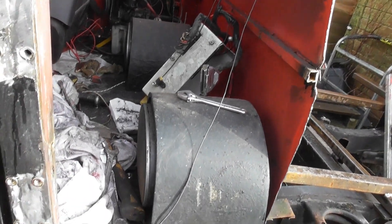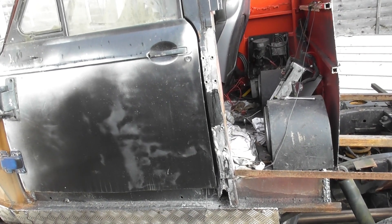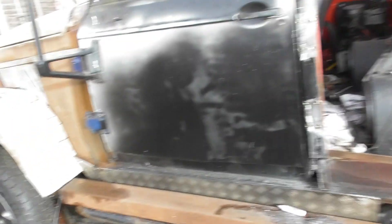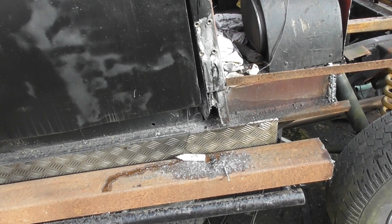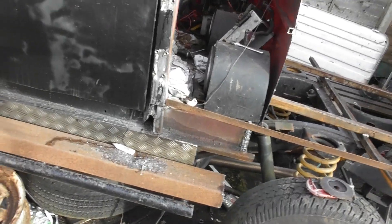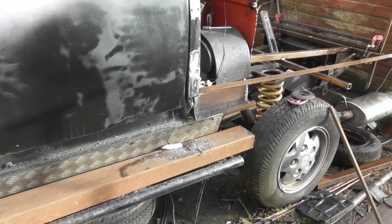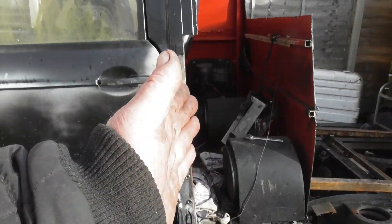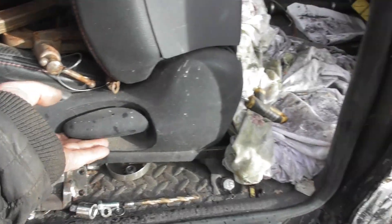I think this is going to be the quickest and easiest way to do this. I'll get rid of these and may very well cut that out and weld a new one in - probably better off just removing it and butt-welding another piece of tin. Then we can start concentrating on those bits under the door, cutting out all the old bits and reshaping and tidying up if it's possible to do that. That door is a mess at the bottom. The other thing I could do - and I'm not doing it - was extend that door out that way. All I've got is this bounces forward, and there's a slider which is a bit jammed up at the moment.